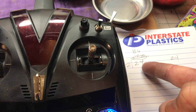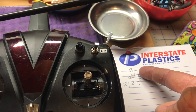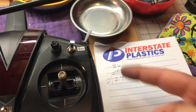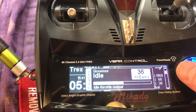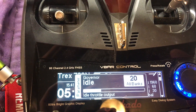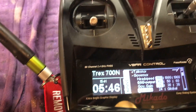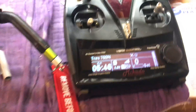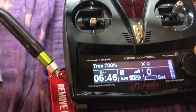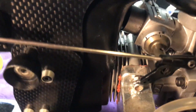It's half the distance between your current global idle and the maximum you'd ever need on a cold day. So I need to set my new global idle to 24. I can't fully explain why these numbers need to be set this way — it's trial and error — but this is what you have to do to get it to work.